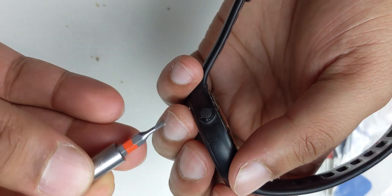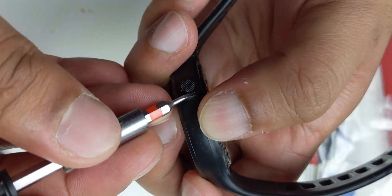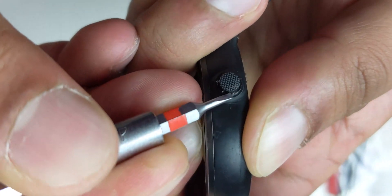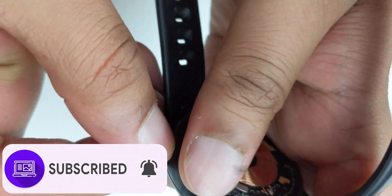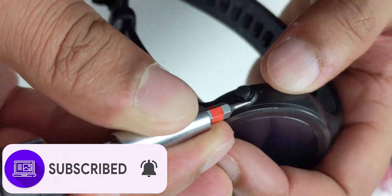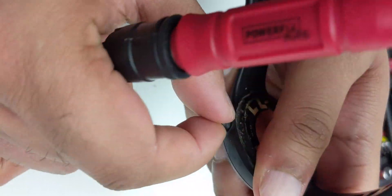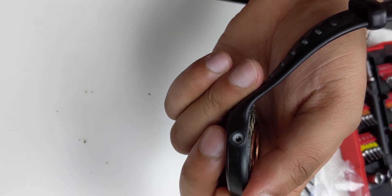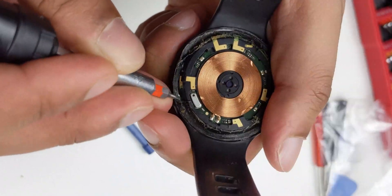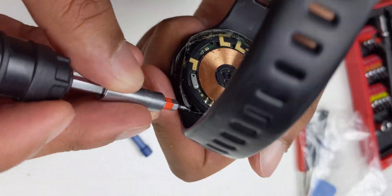I'm back with a very small flat-head screwdriver. Now we don't pry this off — you kind of have to screw it off. So if you see these indentations here, you've got to push on those indentations and it eventually screws off. There we go, we've got that screw out. Now we should be able to lift it quite easily. There we go — there's a groove here that you can get leverage from.